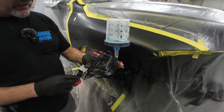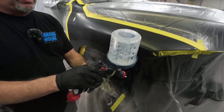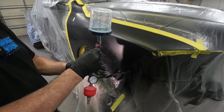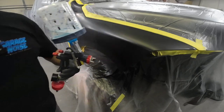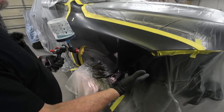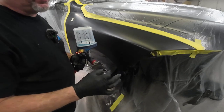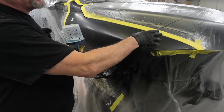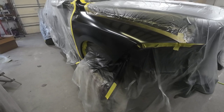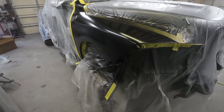On this low volume low pressure paint gun, we're going to set it at about 30 PSI — maybe bump it to 31 or 32. The fluid volume knob we're going to open to two and a half turns out from closed. Fan pattern wide open. We're going to apply one medium wet coat, overlapping 80 percent, with a consistent speed and distance — distance and speed directly affect how the clear coat lays down. I usually spray around five to six inches away at a pretty good pace. Because this fender has a lot of silicone on it, I'm going to lay down a dust coat of clear first to introduce the clear to the surface so we don't have any reaction.